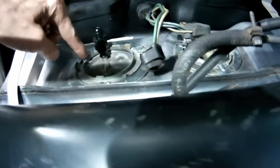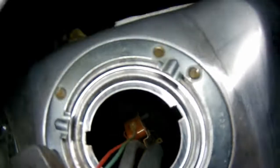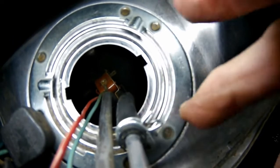Also make sure that your ears are up when you do this because you need those to pound on. When you take the sending unit out, this fuel hose will not let you pull the sender. So you look in the tank and you'll see that that fuel hose is attached. You'll have to take the return hose off right here — take it loose here to pull the sending unit out.